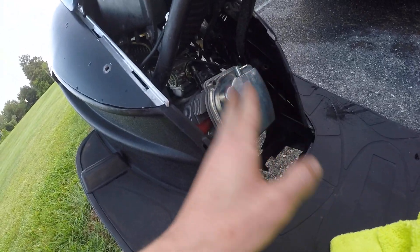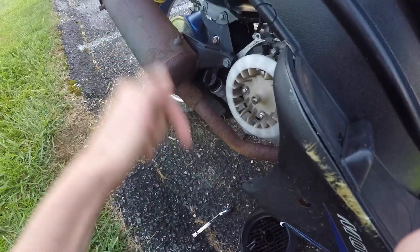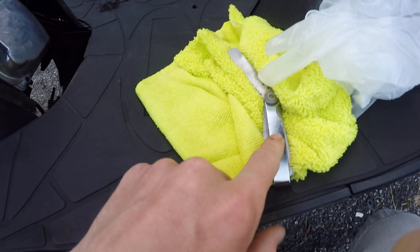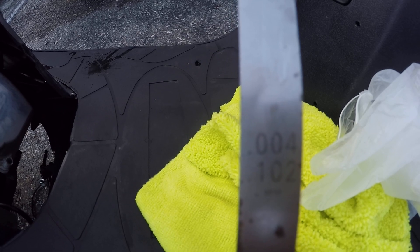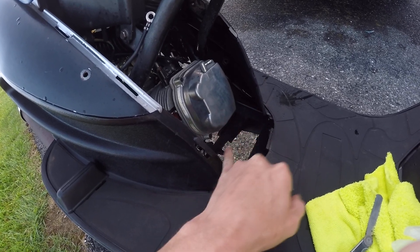It does help keeping it open too, but that fan shroud is definitely better — you're better off just buying an upgraded fan. When mine comes in I'll do the install on video; it's not that hard. So when you do valve timing you're going to need a feeler gauge. 0.004 is the intake side and 0.005 is the exhaust side. You can do 0.005 and 0.006, but I like doing four and five because four is a tighter clearance and just less stress.